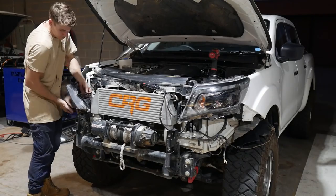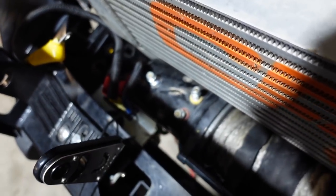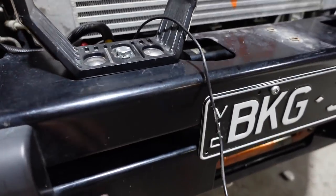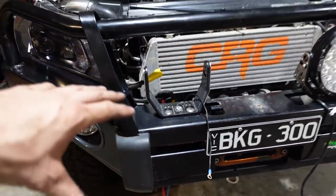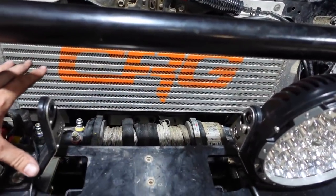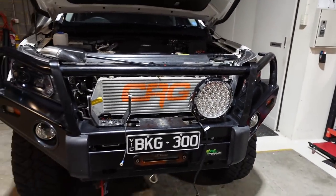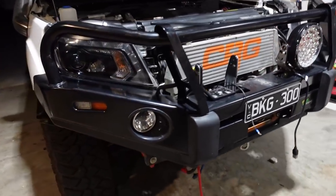The winch solenoid box is right there, just underneath the steady headlight bracket. I've picked up a bolt off there to mount the solenoid control box just underneath it, and you can still access the hand control straight through the bottom of the Ironman bar — everything's falling into place. There's another bracket from RunFor Supply that bolts onto the side of the housing, but because I've got my intercooler there I couldn't fit it, so I had to get a little bit fancy with the mounting — cut a few brackets, drill a few holes — and that's it done. All I have to do now is align the bull bar a little better than last time so it's not as close to the bottom of the headlights.